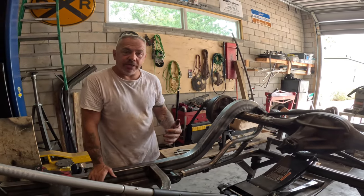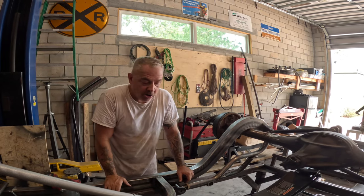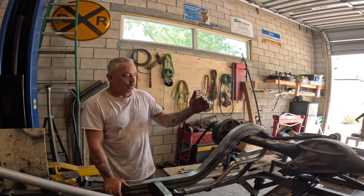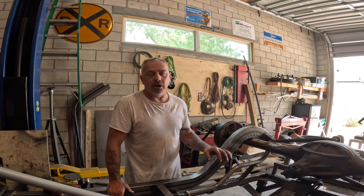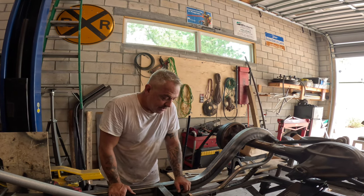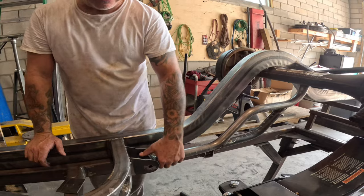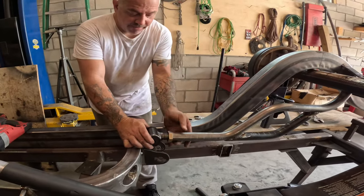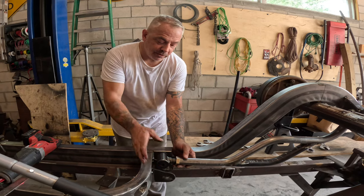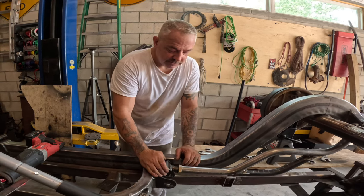What was throwing me off was the bends I put in the bars for being parallel to the ground, and I'll show you that on our cardboard test sample. Essentially right now, when you raise and lower the suspension, the arc is totally off. Timmy and I both came to agreement — we're going to flip this bracket around so the mounting location is higher, more like about here, which is roughly four more inches. It might peek up through the floor, but if it does, I'll just hole saw and make a little cover for that tab.